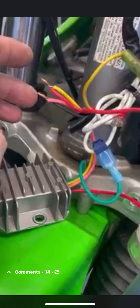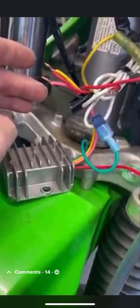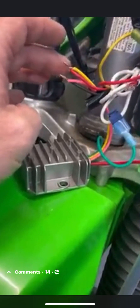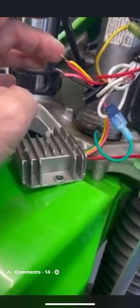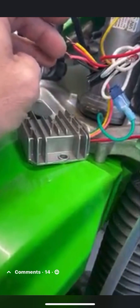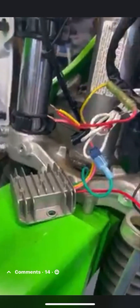That's going to bring DC power to the switch. These two other wires — the yellow and the pink that come out of the rectifier — are what's called the AC in. You're taking the power from the bulb, which is coming off the bike as AC, and wiring it to the yellow and the pink, bringing it into the rectifier. The rectifier takes that power and sends one wire to ground and the other to the switch. That's how the rectifier works.